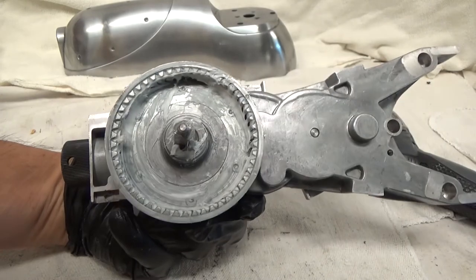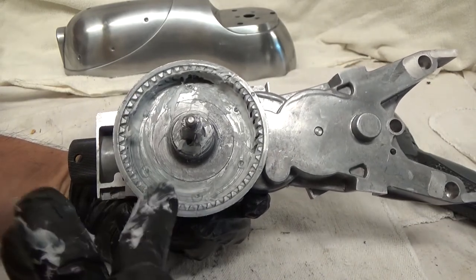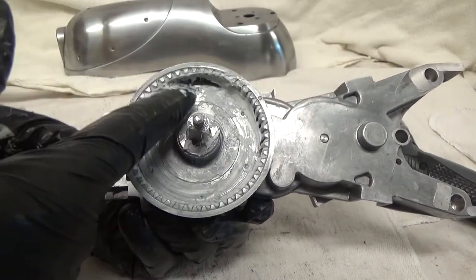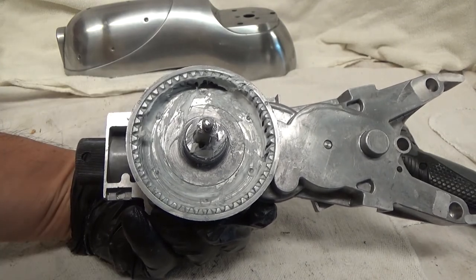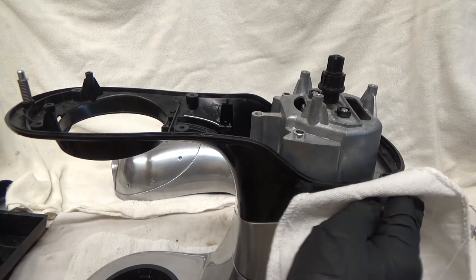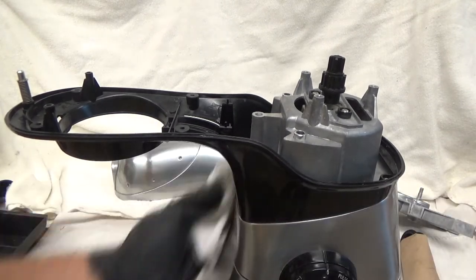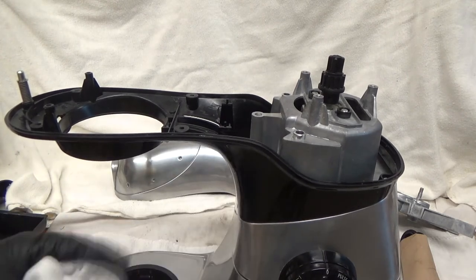I have the planetary gear all greased up. Remember, you don't need to pile in too much — even this is overkill, because once that gear goes around one time, all the grease between the teeth is going to get squished out of the way. The original filming went so long, so I'm going to cut to the chase and show reassembly super fast.